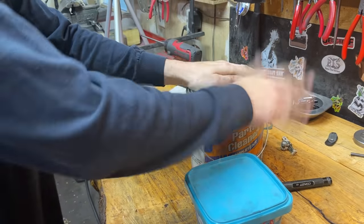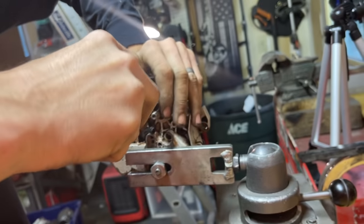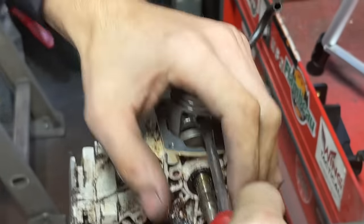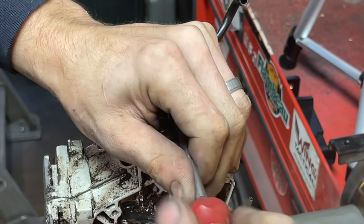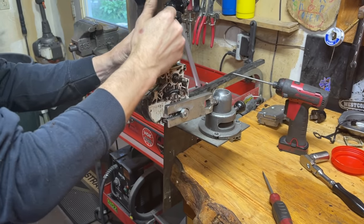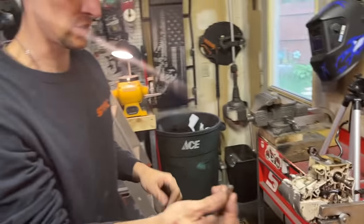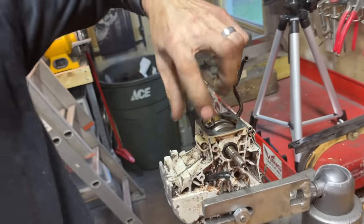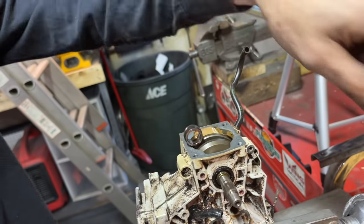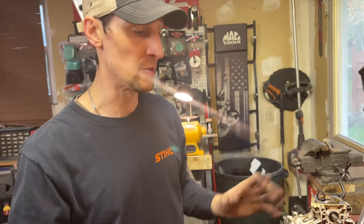We're gonna start cording. Knock that circlip out on the other side — you only need to take one out. Hold the piston so you're not pushing against the connecting rod and bending stuff. Hold down on this and if you have to tap it, there it goes. Keep this bearing — do not lose it or let anything get in it. There is the wrist pin — looks really good. You want to check play with the piston, the bearing, and the wrist pin.